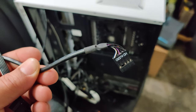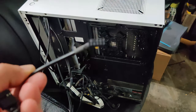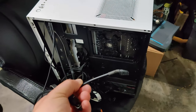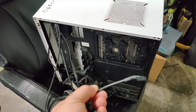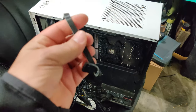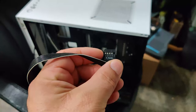All right, so now we got the heat sink on right there. We got the cooler about to go on, the big fan. It actually just grips on the sides of it like that. But what I wanted to note first is that when you're screwing this on, see, it's pretty sturdy, you want to start first, and these screws are spring-loaded, right? And so that's that way when you tighten it down on the processor, it's going to keep nice, steady pressure on it. But what you want to do is you're going to have to push kind of hard when you've got the screwdriver right here.